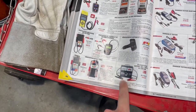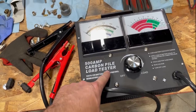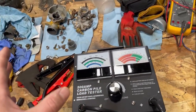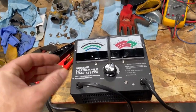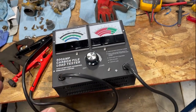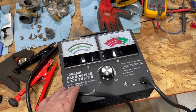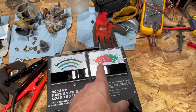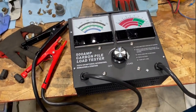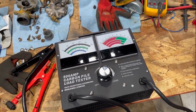There are different models and I ended up springing for the big one. This is a 500 amp carbon pile load tester. There are digital load testers out there that put a small load on it and use an internal algorithm to figure out the condition of your battery. This is a little more old school - it actually puts a heavy load on your battery and then you check how much voltage drop you end up having. Heavy-duty kind of unit, but not that expensive.